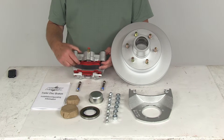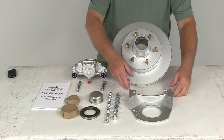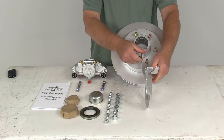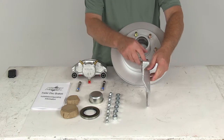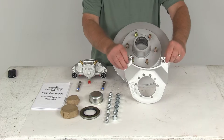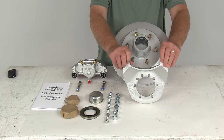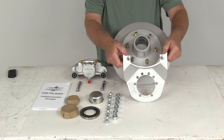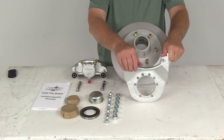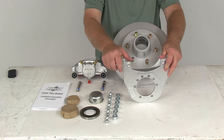It has high performance ceramic brake pads included. The mounting bracket is a cast iron caliper mounting bracket that provides strength and durability. It is a side support design, so it ensures that the load is placed on the whole bracket, not just the bolts. Where the bolts go in, you can see they give extra embossing for additional thread contact, ensuring a tight, secure mounting for your caliper guide bolts. This also is a five-bolt brake flange mounting configuration — you can do weld-on with this, but you do need a weld-on flange which is sold separately on the website.